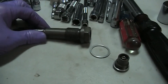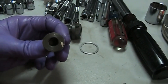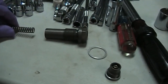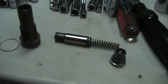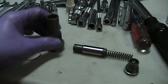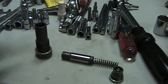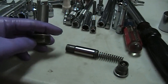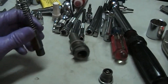If you want to reinstall it, you separate and remove the inner piece. There's a hex on the back — you take it out and slide the pieces out. For installation, you take the outer piece, install a new crush washer, install it, and torque it to 80 Newton meters. After that, you can install the inner parts.